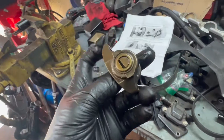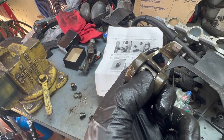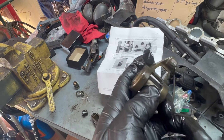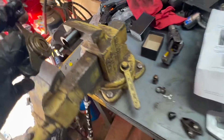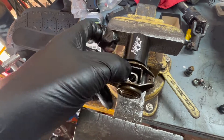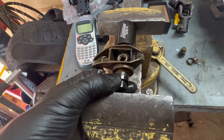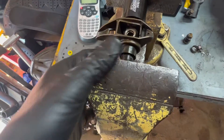See, this trunnion moves so much. From what I understand, when you've got a high lift cam that will break these because you see it locks out — see how it hits there? That's what breaks them. But either way, in our case we're not going to find out. Let me get this in place — boom, it's in place.